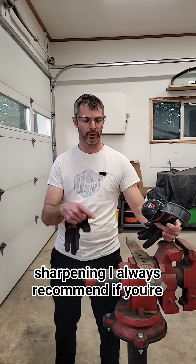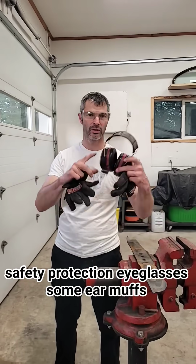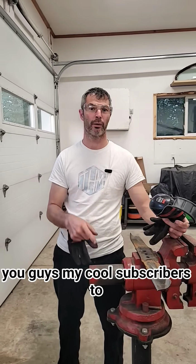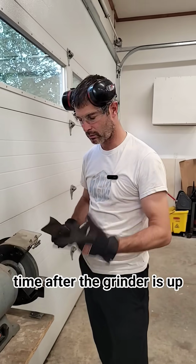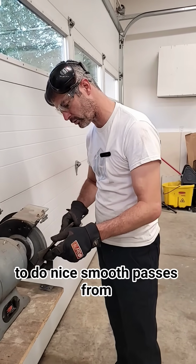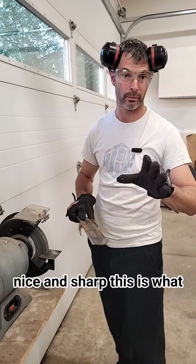I always recommend if you're going to be doing anything like this, make sure you wear your safety protection: eyeglasses, some earmuffs, and some gloves, because I want you guys, my cool subscribers, to be watching me for a long time. After the grinder is up to speed, you're going to want to do nice smooth passes from one end to the other, and repeat that until the blade is nice and sharp.